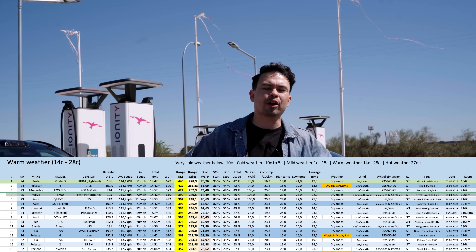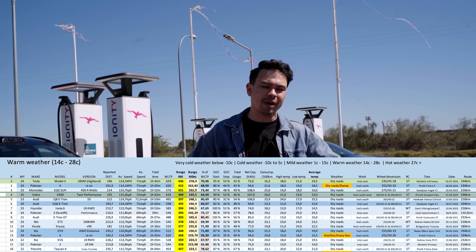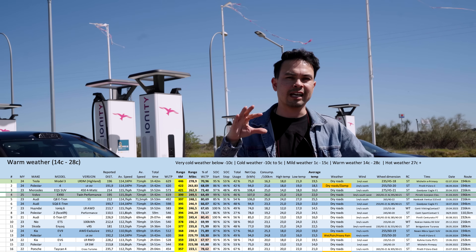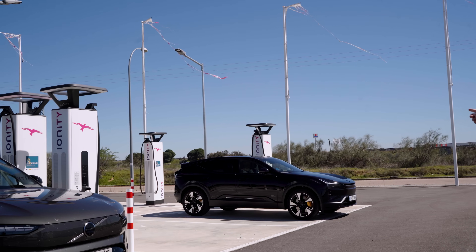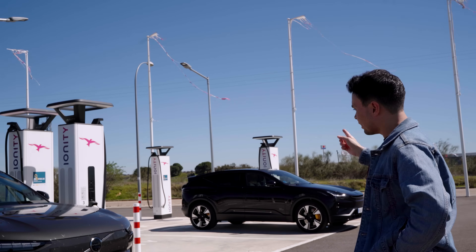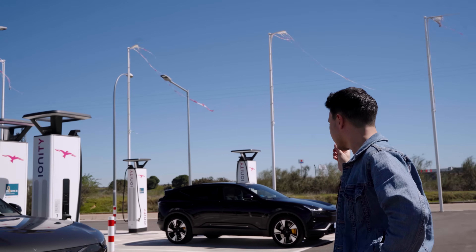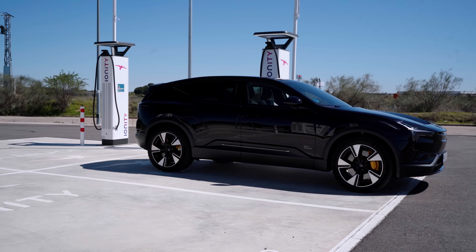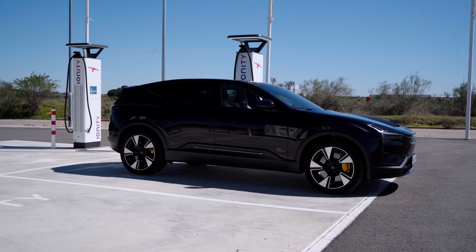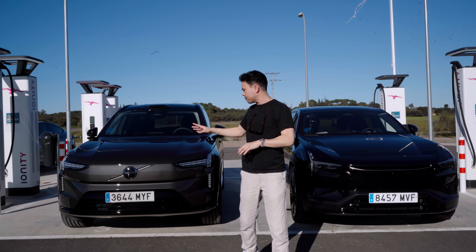I'm a little bit disappointed, but at the same time, I mean — 26 kWh/100km is higher than I was hoping. I was hoping maybe 24, getting closer to 450 km of range. But it's going to be interesting to see in the next video — the Polestar 3 range test, same day, same road, same wheel and tire size — whether it can get more range and if so, how much. Subscribe and hit the notification bell so you don't miss that video, and also the direct back-to-back comparison coming after that.